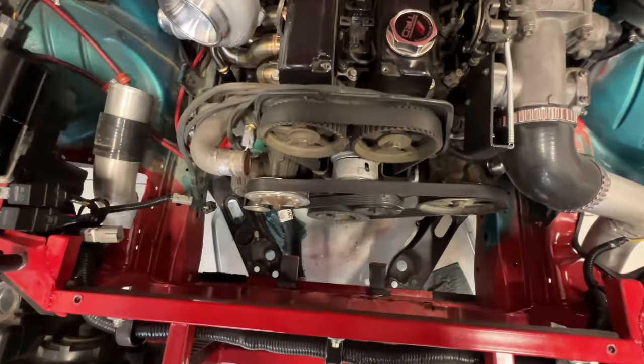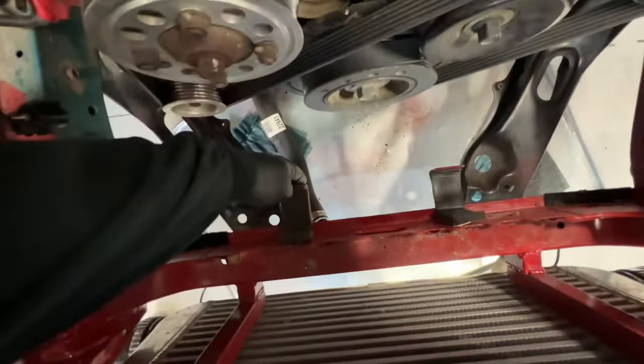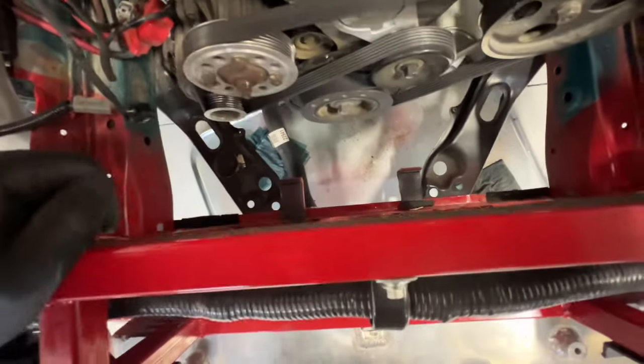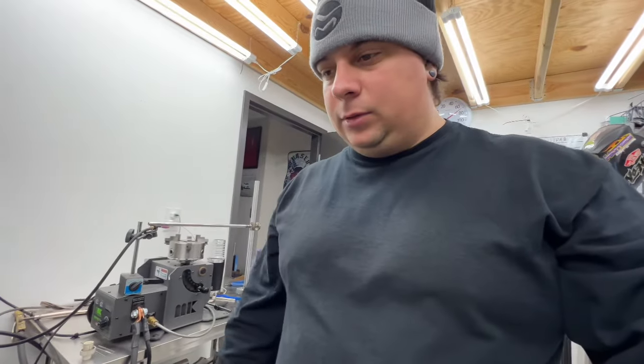So I'm going to cut those bottoms off and figure out a new mounting solution. They used these little U-cups with foam inserts before. I don't know if I'll use that again or not. We'll see. First thing I need to do is get the fans mounted to the radiator. So it's going to be the first order of business, and then start test fitting and clearancing the core support, moving stuff around to get it to fit. Then we'll move on from there. So yeah, let's get into it.